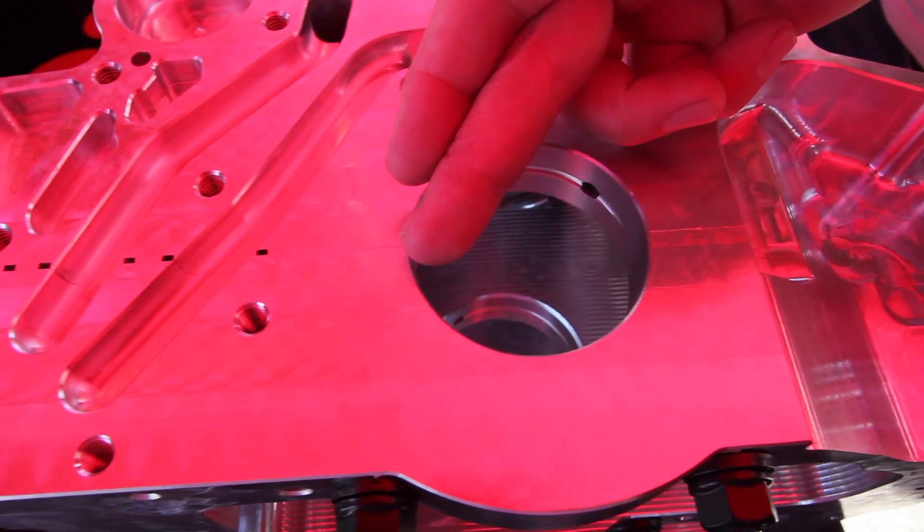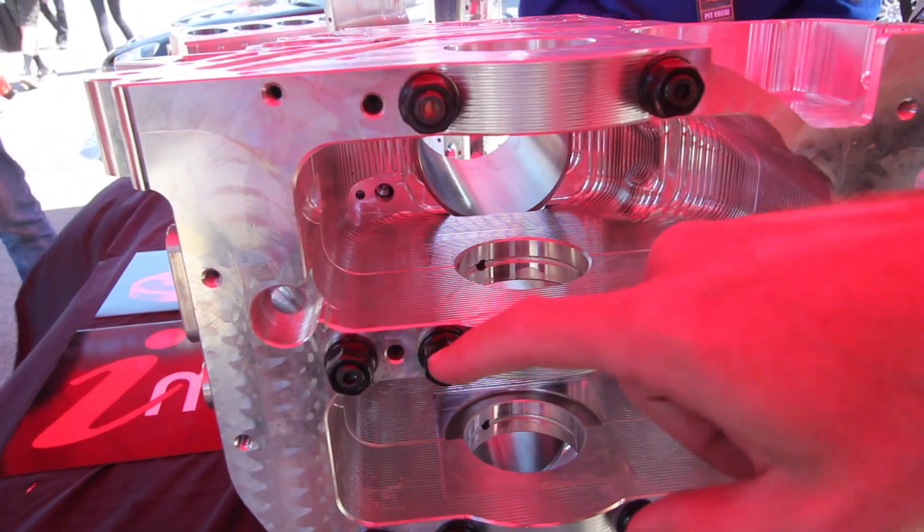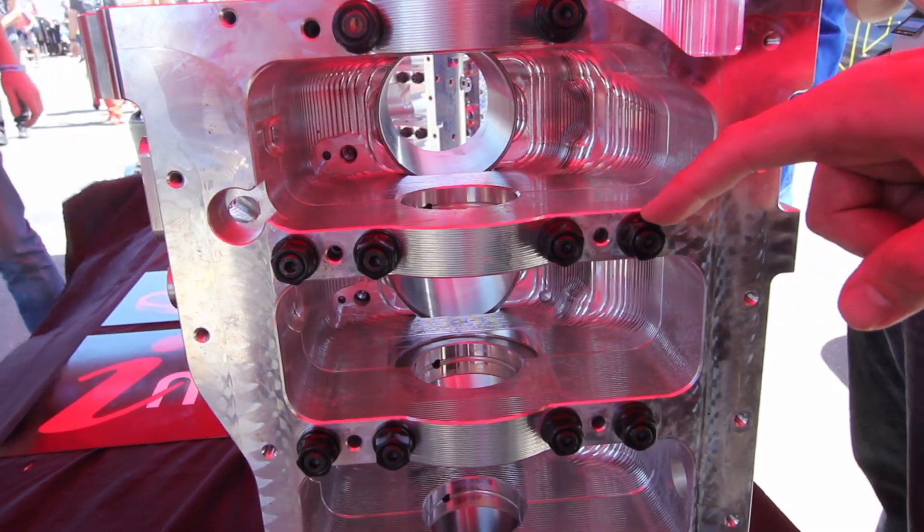What we do is split the block at the crank centreline rather than having wings coming down the sides with a cradle in the middle. We have a one-piece cradle and we've added extra fasteners. We've increased the fastener size — a factory block might have a 10mm fastener; we've gone to 7/16 inch which is 11.1mm — and then we've added extra fasteners on each saddle through the middle, giving a 4-bolt main. We've also added 8mm solid dowels on either side of each bearing journal, which stops the cradle moving and the extra clamping force stops it separating.